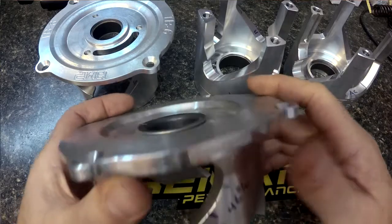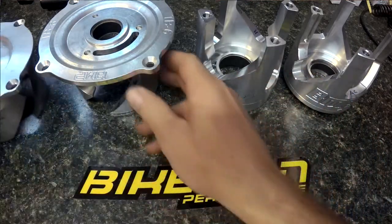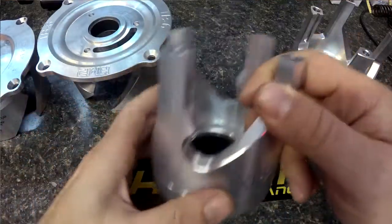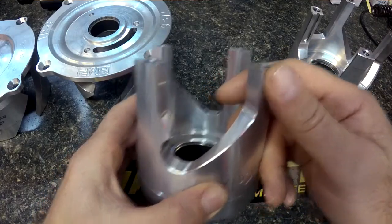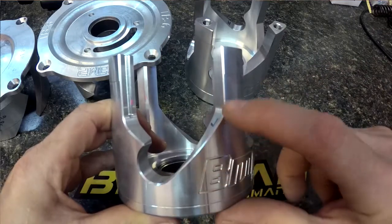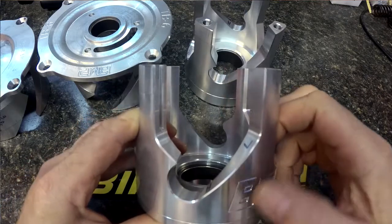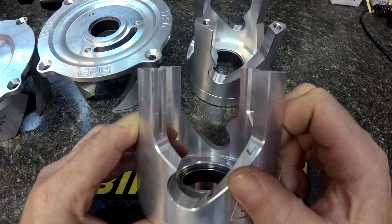You'll have different splits on different helixes, but all of these function in about the same way because all CVT clutches perform similarly. You can see they all have a slight multi-angle to them. We don't give out the specs on our Bikeman helixes because it takes so much time to develop the different angles we use, and we keep them proprietary.